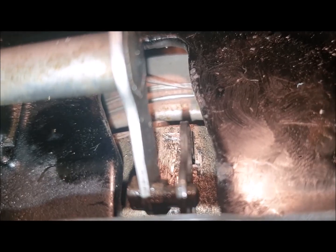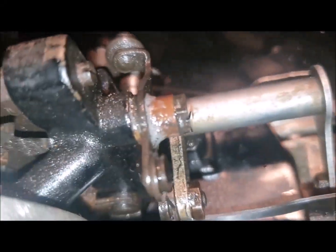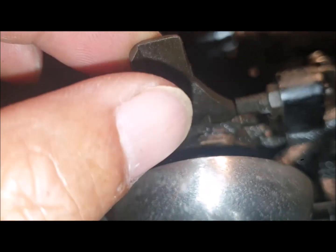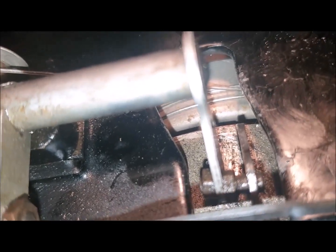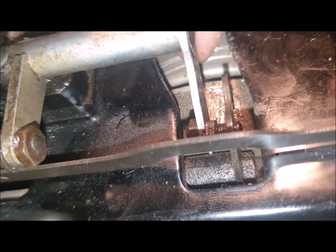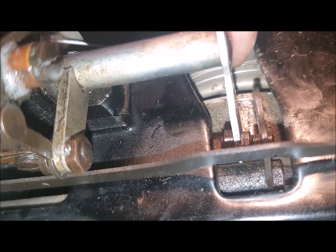But under here, there is a mainspring. This one is a mainspring. I disconnected the draw band and used a fishing wire. So that means release the carriage, and then hit the tab stop like this, and then release. But during that function, this goes down this part and stops the mainspring from turning. So the mainspring cannot turn.